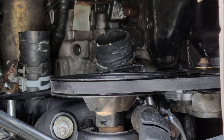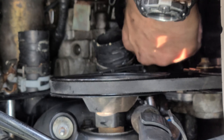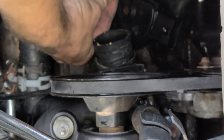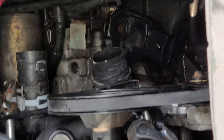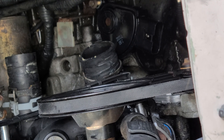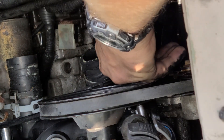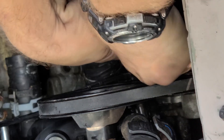Let's get this new one in place. It looks like that should be drive. So what we can do is put one bolt in — let's see if I can get this far side bolt in, it's just off the camera. I'm going to get this one bolt in, get it kind of hand tight, and then we'll have to plug the sensor in. Then we can put the vehicle in reverse and turn the sensor until the reverse light comes on. At least that's what I've done in the past with other sensors — I haven't looked up the spec for adjusting this one, but I'm sure it's pretty similar. Let's get the connector. I'm going to go ahead and blow this thing out — cover your ears.